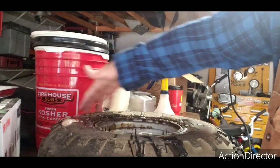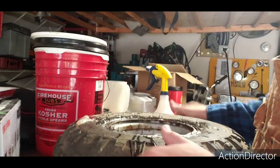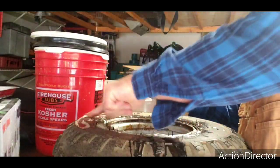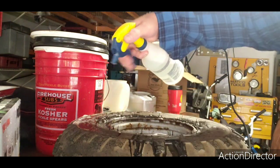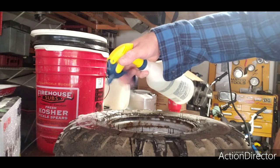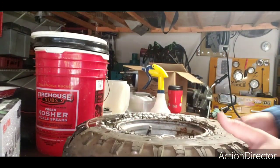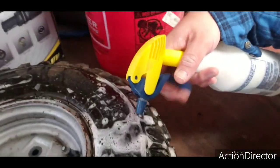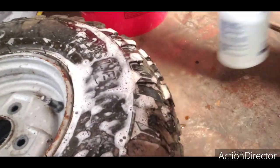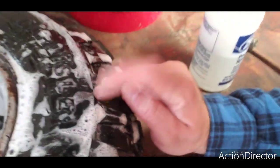So you want to keep spraying all over the whole tire. Unfortunately, I've found the leak on this one — there's a big spot on here where the tire is dry-rotted. It's probably from it just sitting with no air in it. See right there, my finger's pointing — I hope you guys can see that. There's air leaking out right there.